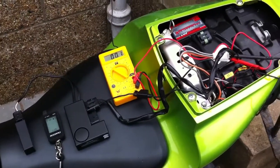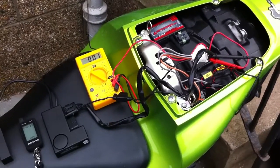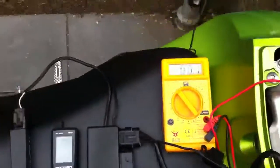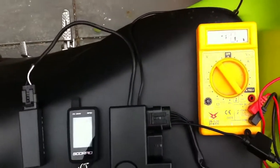The bike's turned off so the alarm's actually armed at the moment. I've removed the MCN from the back of the bike and put a voltmeter into the orange cable and the ground cable from the harness. It's reading zero volts, or as good as my rather uncalibrated meter is showing at the moment.